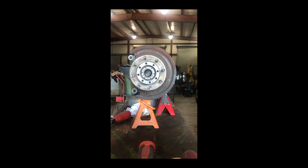The point of what you do is you heat the side that you want it to come to. I need this to come back, so I'm heating the back of the housing. Then you'll watch it move to the front and then come back further to the rear. It's really very time consuming to straighten this housing.